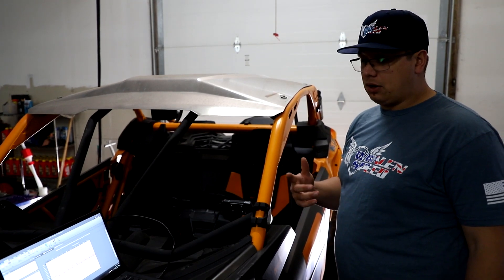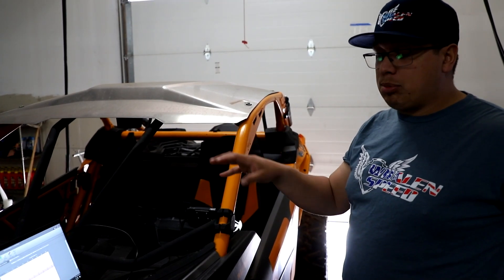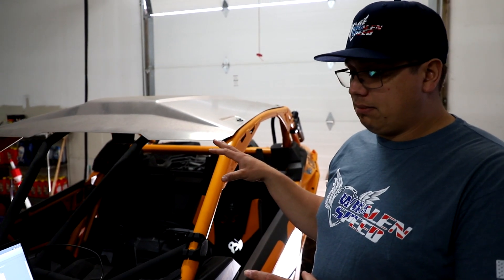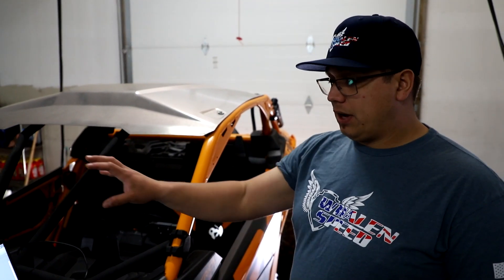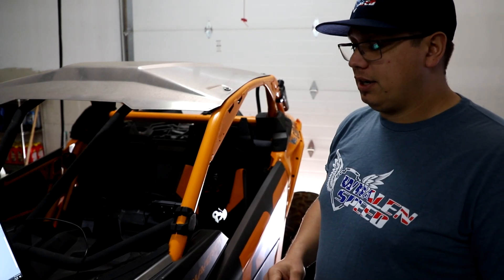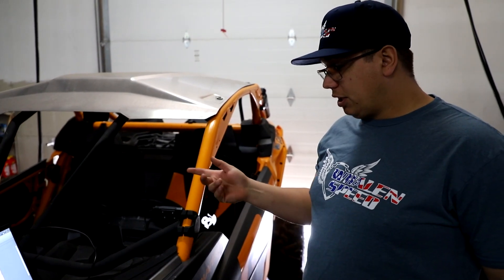I'm going to start the car and go over the process — how I launch at the current engine speed and how it all works. You don't need to use the brake pedal. You could technically put this on anybody's tune and configure your launch control yourself, or buy it pre-configured from us. This is just an external device — it doesn't mess with the factory ECU at all. We've updated all our tunes to handle the misfires, because technically it is misfiring — we're purposely cutting cylinders and introducing a misfire to do what we want for launch control.